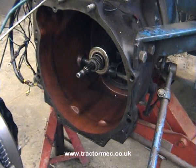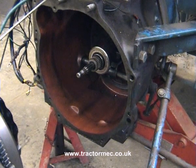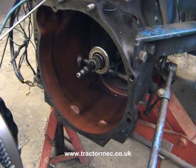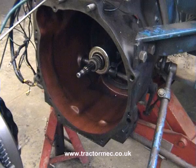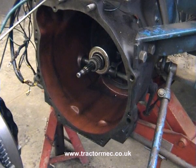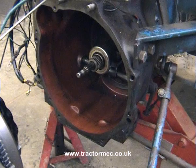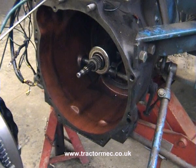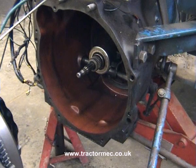Note here how clean the bell housing is — usually not as clean as this, so the first task will be to clean inside the bell housing. Bear in mind it might be asbestos dust, so take precautions. Keep everything nice and damp with a damp rag, damp water to damp everything down with. Otherwise asbestos dust gets into the atmosphere and we breathe it in, causing asbestosis.